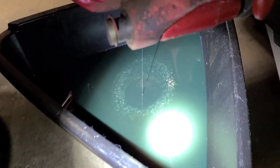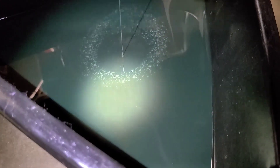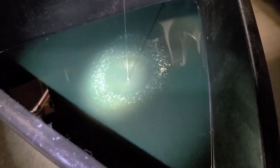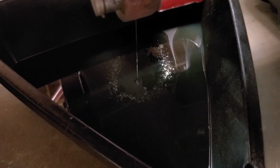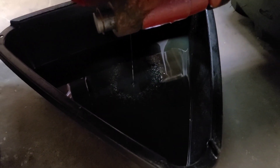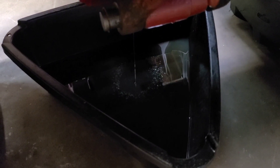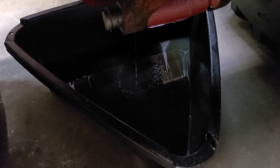You can see the sparkling in there - there's a little bit of shininess, but that's to be expected. I mean, it was all brand new bearings and all brand new bushings and shims, and this is the second summer on this oil. So nothing alarming. We'll just let it drain and fill it back up.